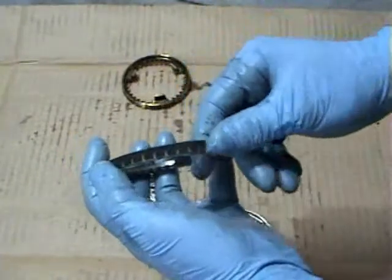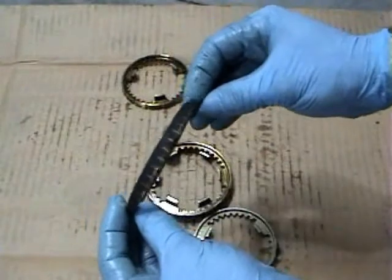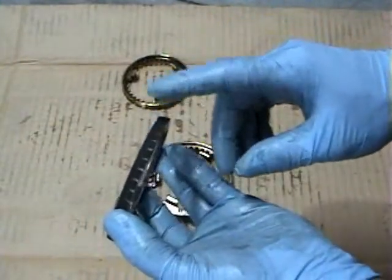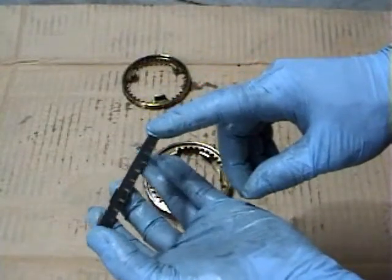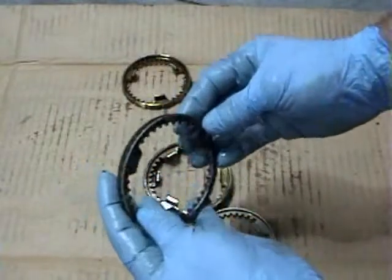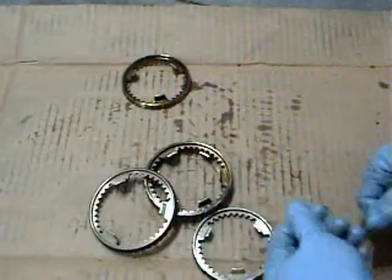This actually feels like sandpaper. So first and second are going to feel great. And that's another reason why you have to upgrade the shift collar even if you just want to change the synchronizers, because this is a lot more abrasive and the new synchronizer collar is actually stronger. So it's pretty much mandatory to change all your synchronizers and that one-two shift collar. But that one-two shift collar almost always gets messed up, and that's usually why they get taken apart.